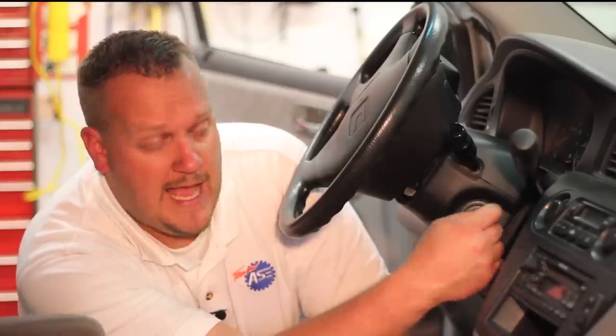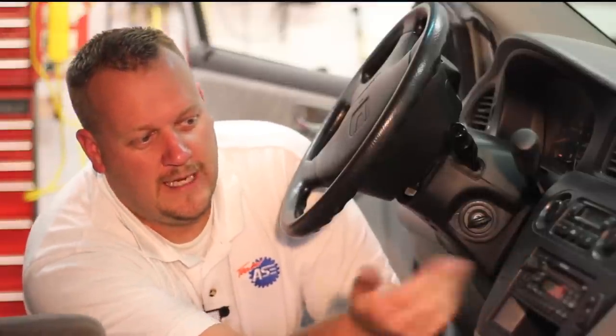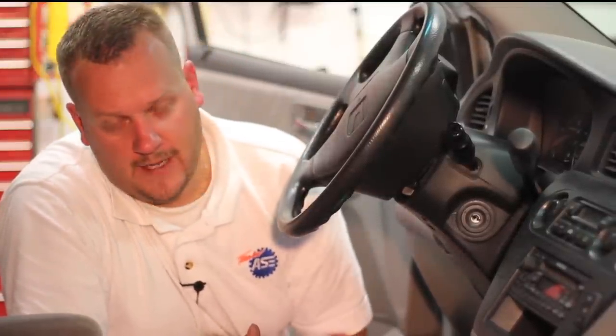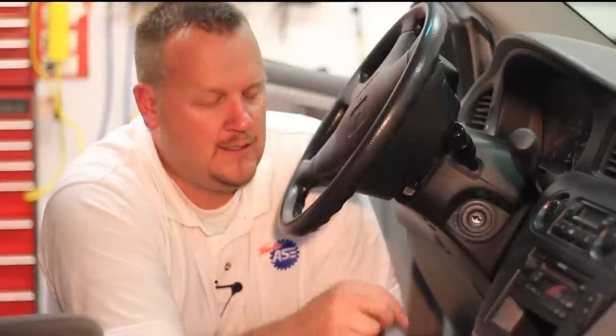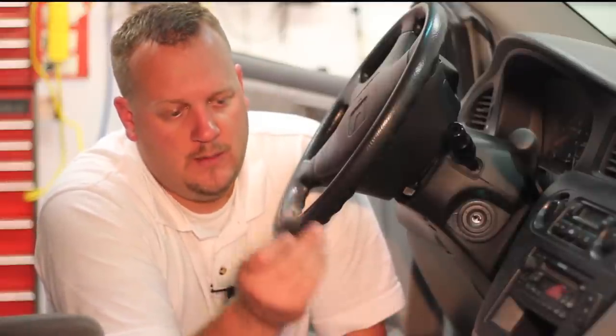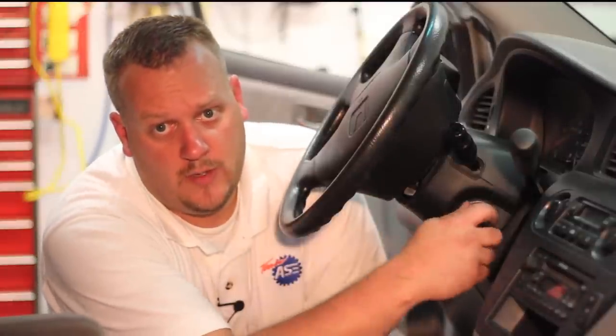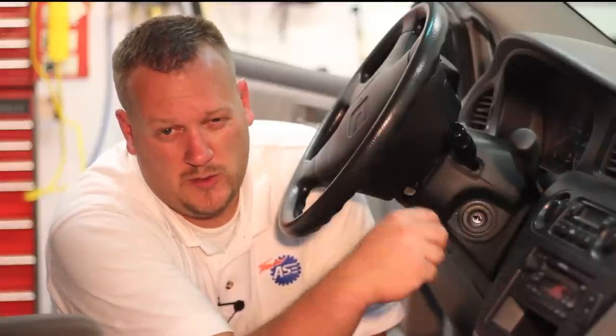With my new cloned key, it fits the lock cylinder, it turns — and the vehicle starts and runs. The radio even works after entering the code. Another option, if you have access to a Honda factory scan tool, is to enter a date-specific PIN code to learn a new key to the vehicle. You'd transfer the information from your original key, get it cut to match the keys that came with your lock cylinder, and you're ready to go. Hope you've learned a lot about replacing the lock cylinder on an early 2000s Honda product.